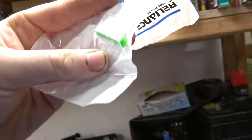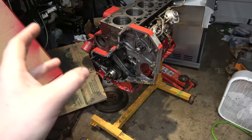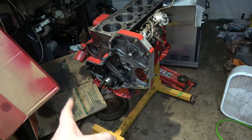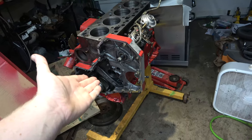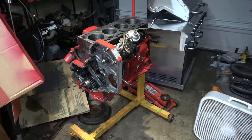This one uses the short tubes, and I got the long ones. The second problem is we were going to take the crankshaft back out to replace the piston cooling tubes. But guess what? Someone put the timing case back on and it's all sealed up. So we'll just run those.